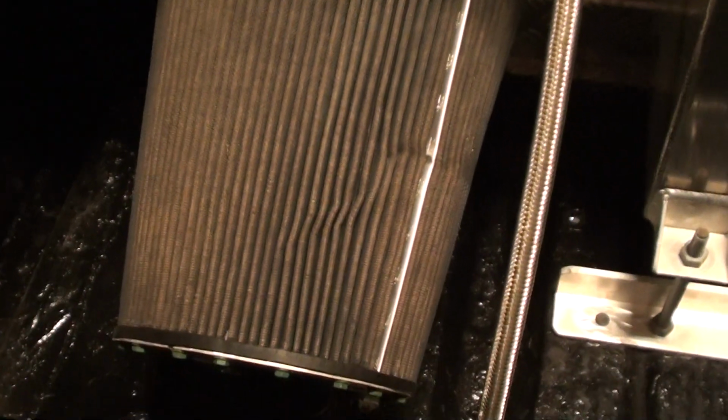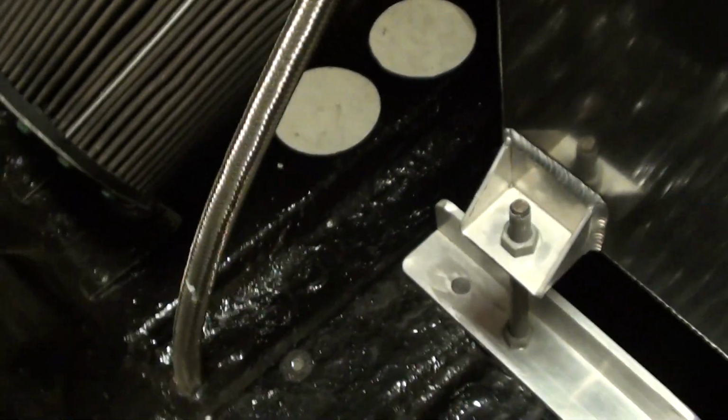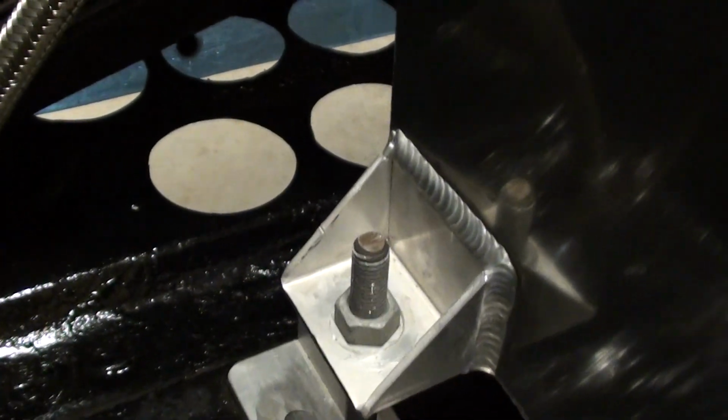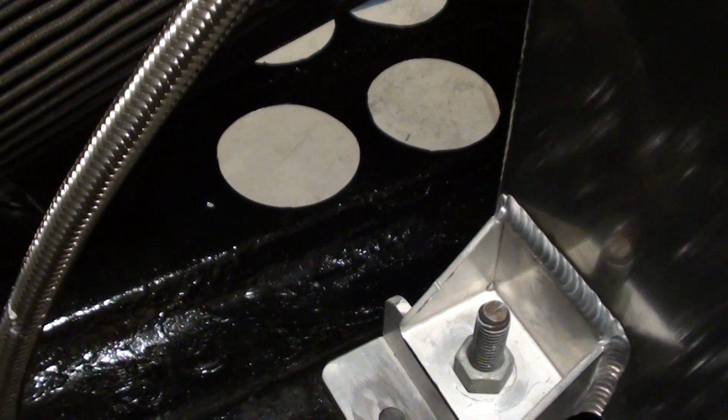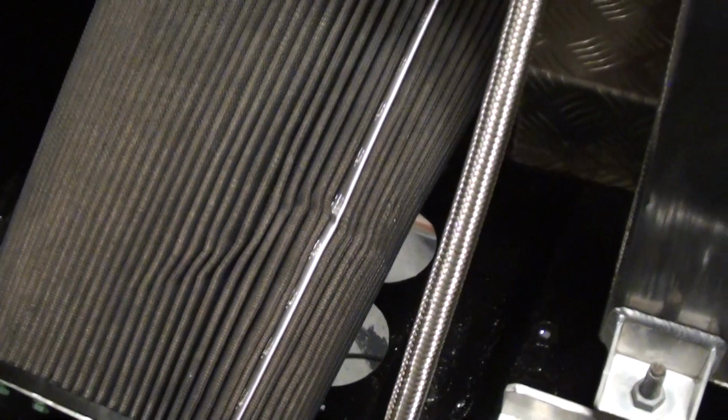That filter is off an F truck, a diesel F truck. I've sort of made up ends for it and fabbed it up, and I've got a nice 4-inch feed for it, 100mm. It's a bit agricultural, but it works. That's actually sewer pipe, that waste pipe, 100mm with a flared socket, and I can take this off, clean it, and service it with a bit of flexible pipe, and it's worked a treat. So it's been brilliant. It doesn't get dirty. I've got 4, I don't know, 5 3-inch holes for the air intakes there, and plus you've got gaps around the boot and whatever, and that's the intake for it. And that was a good little idea, old mate came up with that, so yeah, real happy with it.